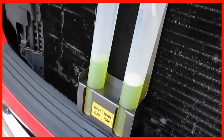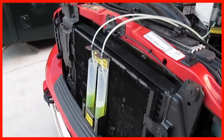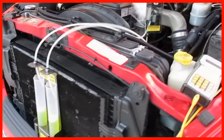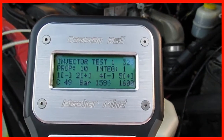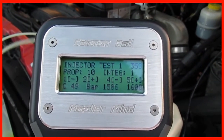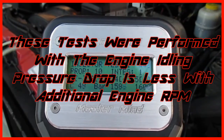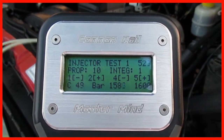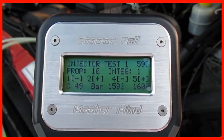We've got fuel coming out going into our beaker. It looks like we're at about 140 on the return once we've started the test. As soon as we started the injection pulses, we would have read what the return rate is — just want to get in the ballpark to show you how this thing operates. On the top right it shows how many pulses we're on: 300. You can see how it's maintaining the rail pressure, and it's going to drop every time the injector hits — 1580 to 1600 roughly every time it hits. This is actually averaging the bar, so what you're seeing there is not as it's really happening because we have to average it; otherwise the numbers would be changing so fast you wouldn't even know what pressure it was putting out. So this is a pretty good approximation of where it's at.